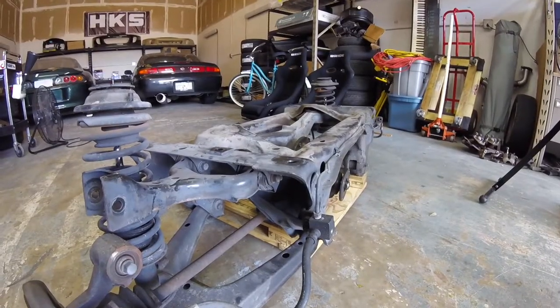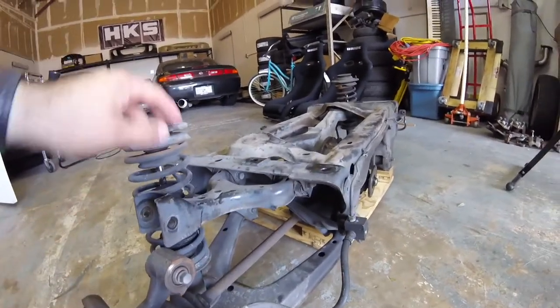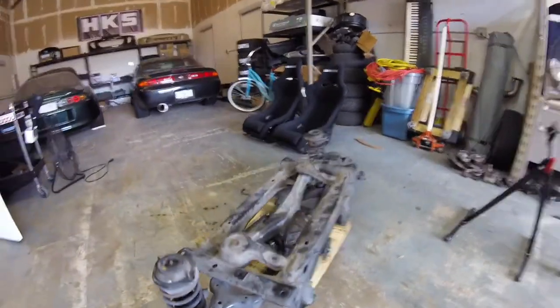These arms will be stiffer. I'll have heim joints connect them to the chassis so there's more adjustability. And then I can scoot everything up a little bit more, get it a little closer. So I think that's what I'm going to do. I do wish I had a cherry picker though — this seems heavy as heck. If I take the uprights off and the diff out, then the subframe isn't too heavy. I can put it on the table and start mocking some stuff up.